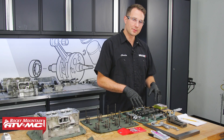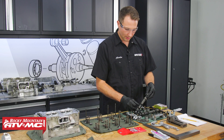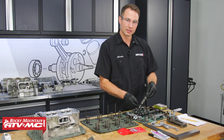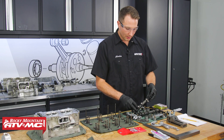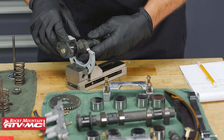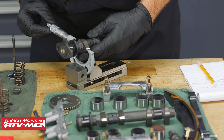The next thing we'll do is inspect the camshafts, starting with a visual inspection. We'll make sure the cam lobes aren't rounded off, and then I'm going to run my fingernail across these cam journals — if there's any grooving that your fingernail catches on, then you want to inspect that closer and replace the camshaft if needed. Ours is looking pretty decent, so we're going to take measurements both on the cam lobe at its highest point and on the cam journal, and compare those readings to the spec in the manual. If those readings are good, we're going to reuse these camshafts.